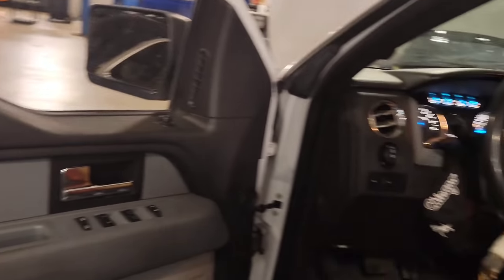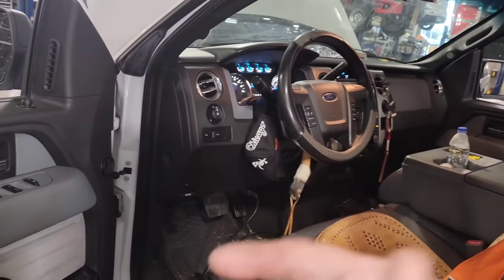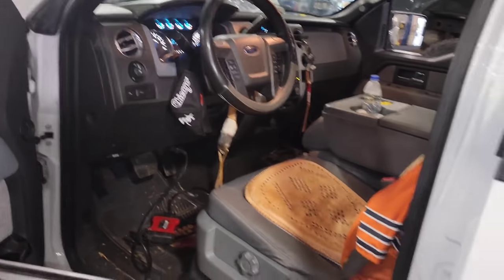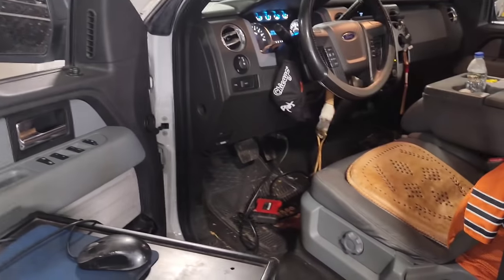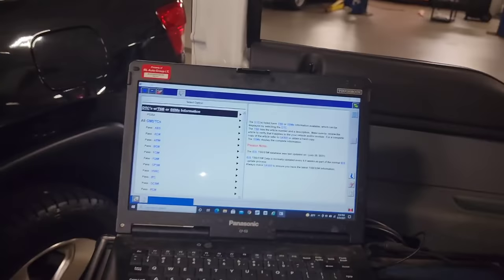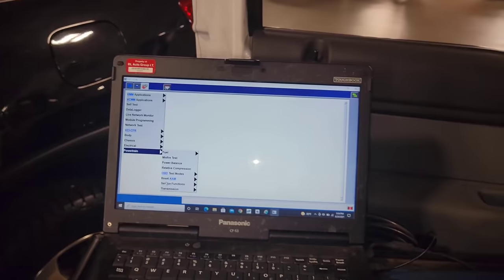If it stumbles every time you fill up the gas and it doesn't want to start right away or it runs rough until you drive for a few miles, replace the purge valve. The tank getting sucked in like it is down there, it could cause fuel level reading issues. So that could potentially be a problem in the future. What you could do is go to the dealer and have them run an EVAP test.